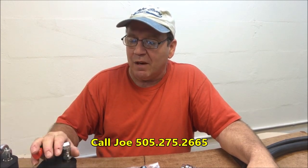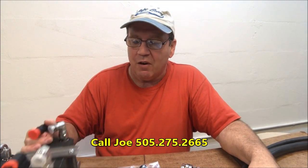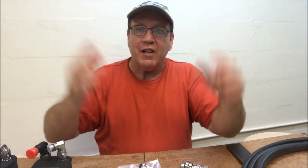And so one of the things we're going to do now, because it's going to take a couple of weeks for me to get this on the car, we're going to go over to 5 Bar this afternoon and put my car on the dyno. We did a baseline pull on this car when we first put the blower on it over at Steeda. It was a very hot day that day, something like 93, 94 degrees. We put it on the dyno, it was a Dynojet, and we were trying to get good numbers. We had the hood open, we had fans blowing on it, we let it cool down, and we managed to get 638 horsepower to the rear wheels, and I think it was 486 pound-feet of torque.